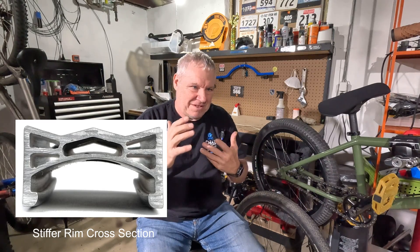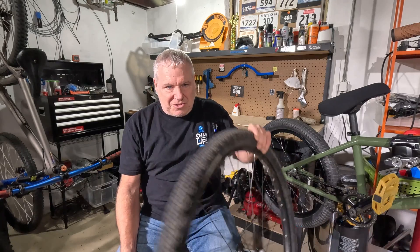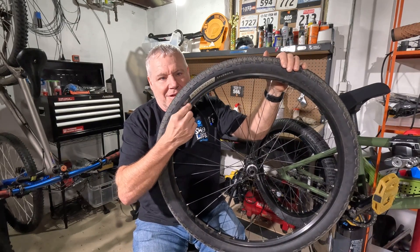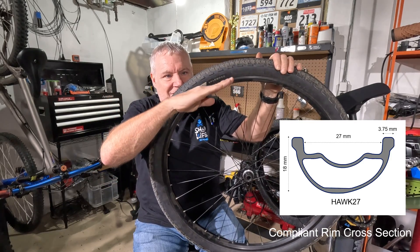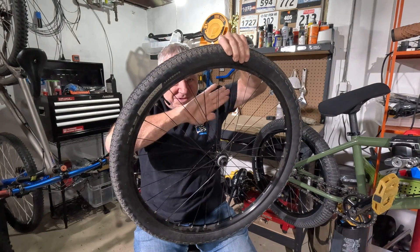The spokes are going to hold a really stiff rim in place, and that rim is rarely going to want to flex out — it might still have a little bit of give but not much. They'll do double wall, triple wall, vertical supports inside the rim to make it really stiff. On something like a 29er or mountain bike, they probably build in a little bit of flex and compliance so the rim will actually flex a little bit.